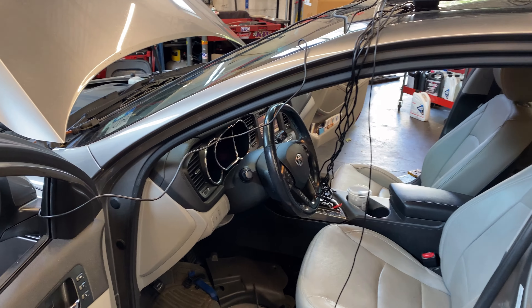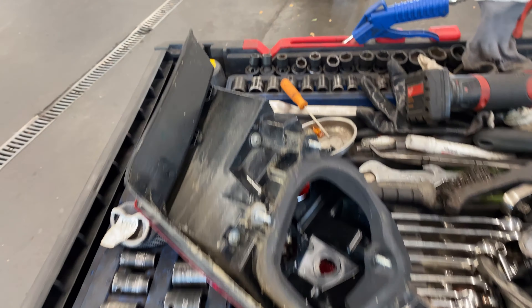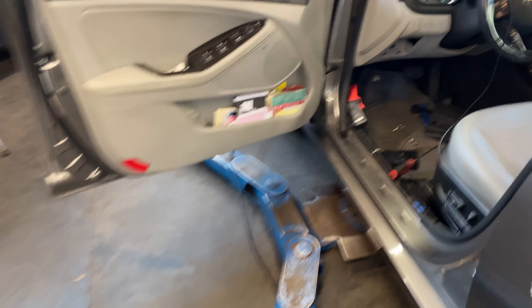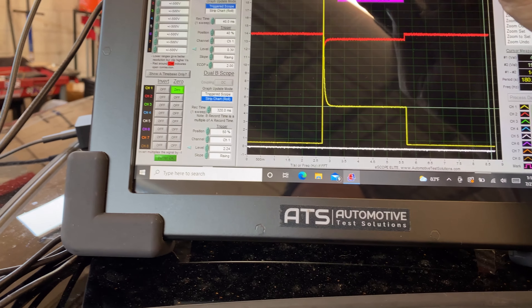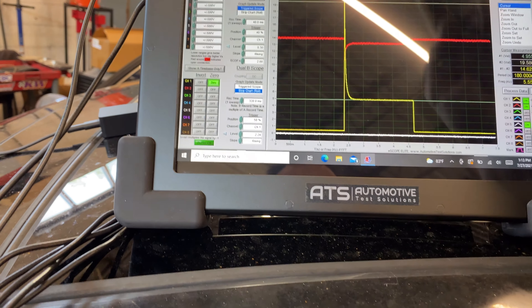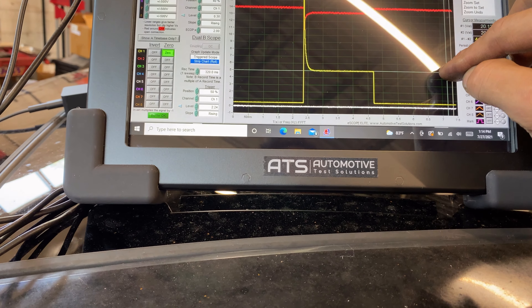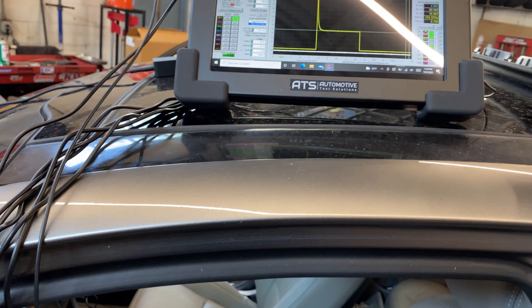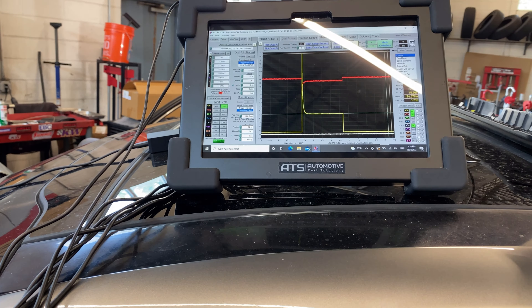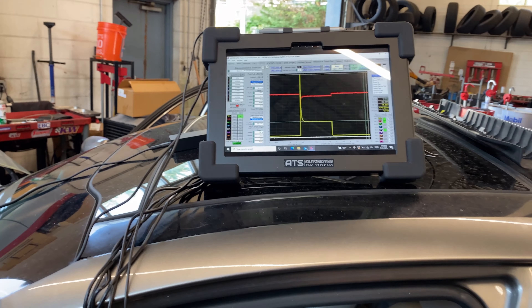With the tail lamp completely removed — just the wiring harness stub — I'm pressing the brake pedal live. Look at the amperage: completely normal. Now putting the lamp assembly back in — the voltage drop is fine at about 13.5 volts, and amperage is 4.9 amps — nothing wrong with that. But with the full original assembly connected it goes to 22+ amps and blows the fuse. The data doesn't lie — we just need to get a new tail lamp. Something is shorted inside that assembly or frame. That's 100% the problem.